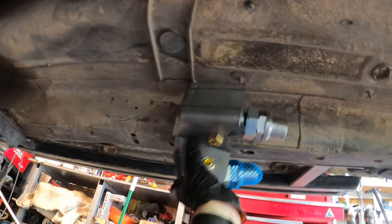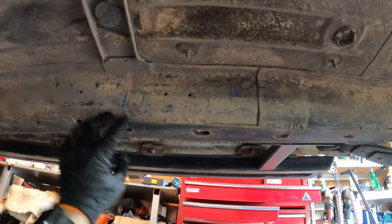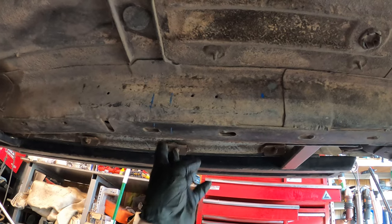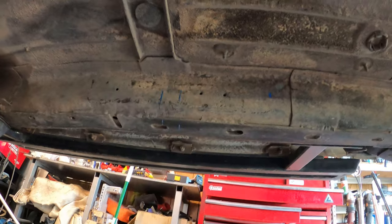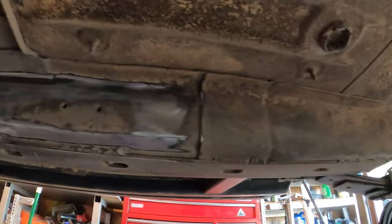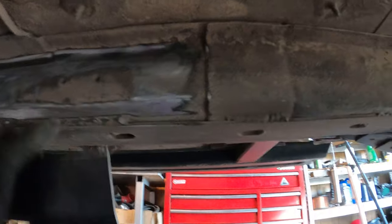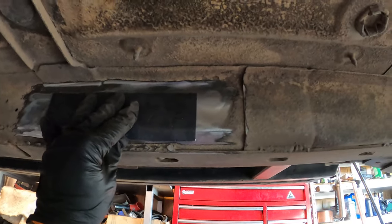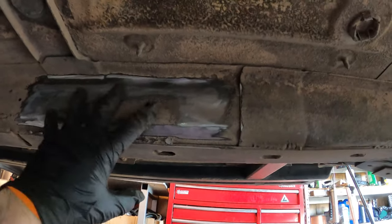So I just gotta add a plate in here about 6 inch by 3.5 to tie it into my frame stiffener, because the bottom is a 3/16, and I think I'll add a 1/8 up here, and that should hold it perfectly in place. Well, got that cleared up, so this piece of steel can go in here like so, and we can weld it all the way around and reinforce the side of the channel so I can weld to here and here.